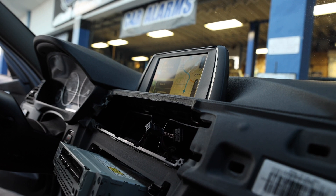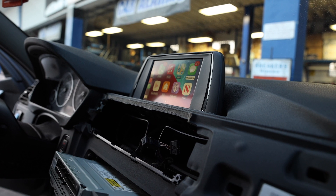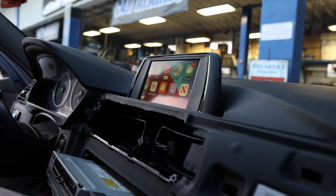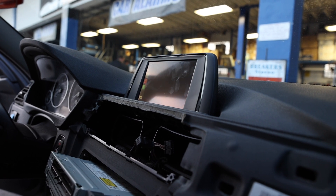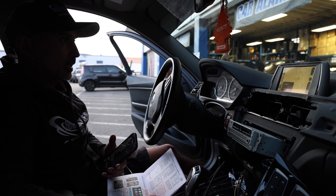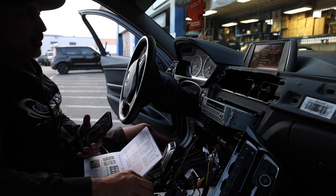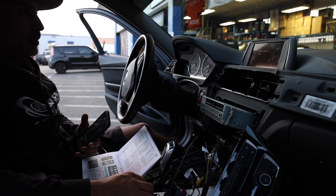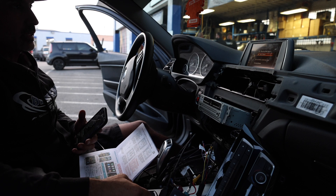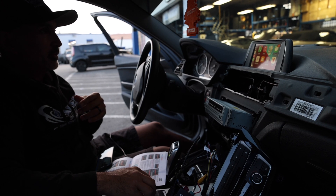Basically you can scroll and as you move the iDrive around, it moves the cursor around. If you want to hit enter — just like if you're touching the screen, you would touch that — and that takes me to the main menu. From here I can do phone calls, navigation, and music. I do need to go back and select auxiliary for the vehicle — going to multimedia, external device, and selecting auxiliary. Now I'm back to Apple CarPlay and it's playing music.